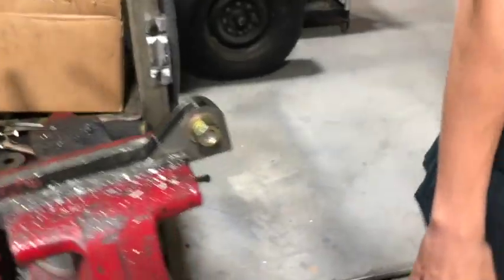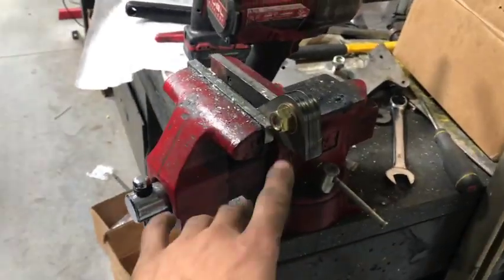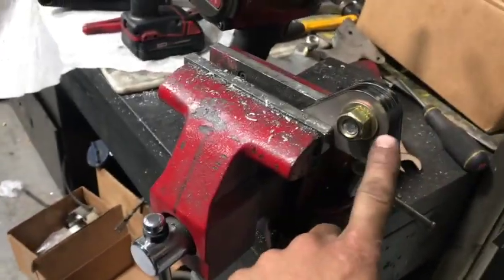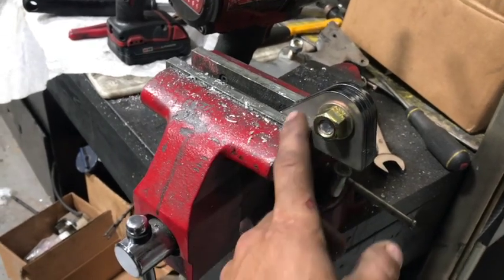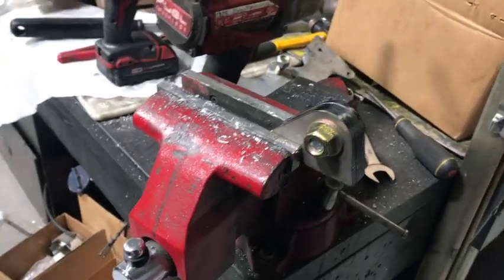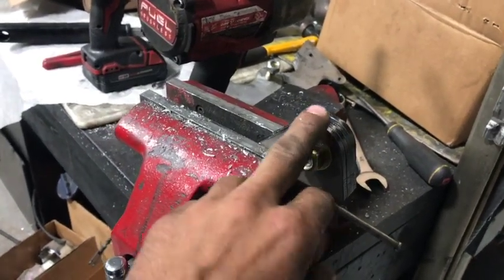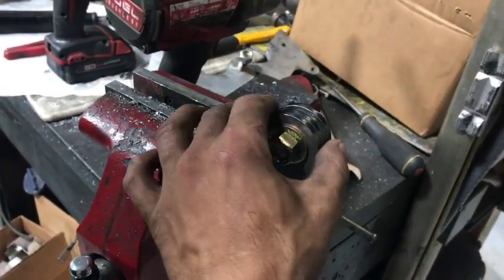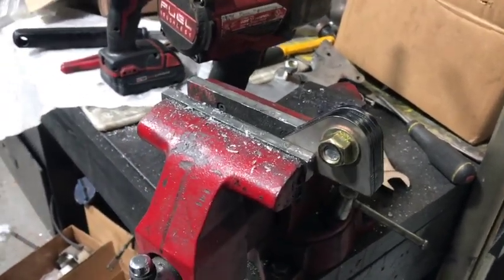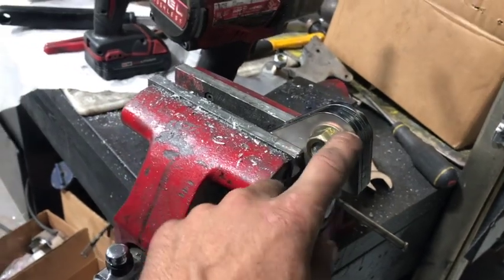Here we are with Race Cars and Snacks. We're going to be modifying some brackets that will be used as shock mounts — going directly underneath our rear frame rails. With the shocks we don't have a whole lot of articulation, so we grabbed some regular half-inch bolts with a three-quarter-inch head — that's the size of a washer — to get a little more articulation on the shocks. The shocks are going to be operating on about a five-degree angle, so we vice-indexed them all and we're going to take off some material.